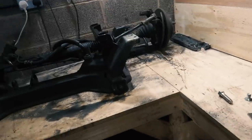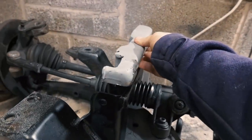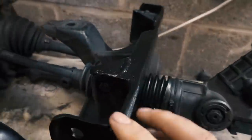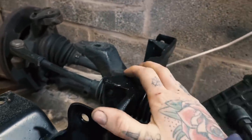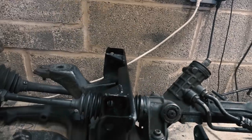Right then, the batteries ran out last night, so I'm back today with charged batteries, and I'll show you what I got up to yesterday. So this is the subframe here, and what you usually have are these bits on top there. I've cut 30mm out of this, and then I was left with the bare top, and then I've notched a piece of box section along the back and put some gussets in and welded that on. So hopefully this shouldn't foul the floor of the van.